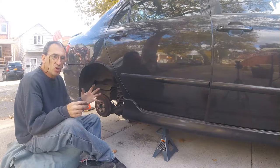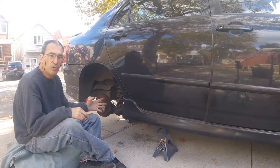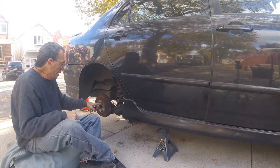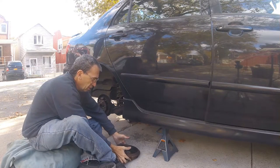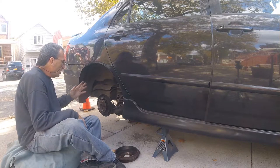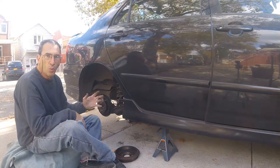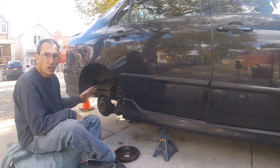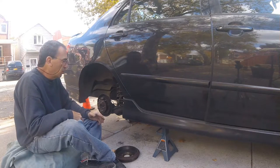I'm going to show you the unconventional way, and how long and tedious it is to do a drum brake. I'm not a pro, so it's going to take me some time. There are two holes here — I already removed this the last time and it came off very easy. Take some lubricant, spray it around this area if you're having trouble. Rotate in an M8mm bolt and the drum will come off. Protect everything around you, take a look at the drum, and do not do the other side — use it as reference until you complete one side. When everything is done, don't test your brakes unless you've got your drums back on, or everything is going to spring out and you're going to be in trouble.